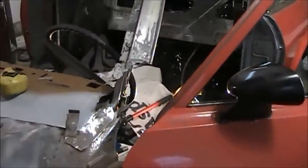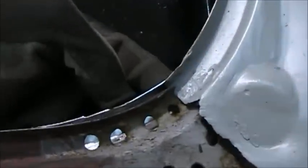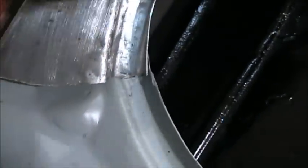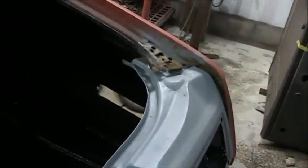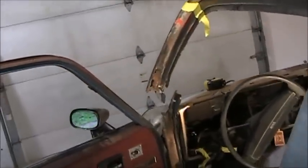or halfway straightened out. And like I said, this is very important because everything starts here and I got to work my way back, get everything lined up. I did make one piece yesterday that I need in here. It goes underneath in this part here. Spot welds to it, but I gotta get it fitted on there. It's got to be welded, trimmed, welded in there, so it does fit pretty good. It's just a little long here and a little long there, so I'll trim that later, and it goes underneath like that one. So that's one piece done, so I'm ready for that when I get there. It's just that's a hard fix, and well, I gotta go slow, try to get it right, so I'll be back here later on.